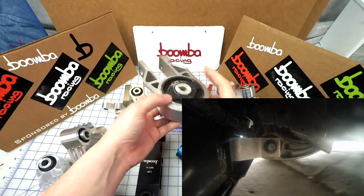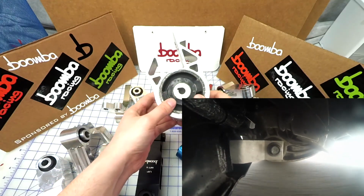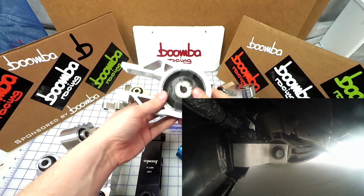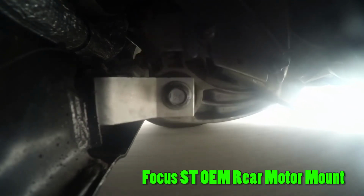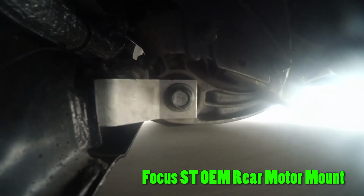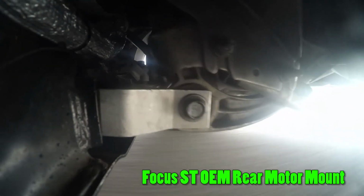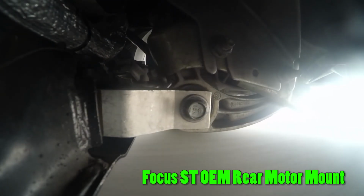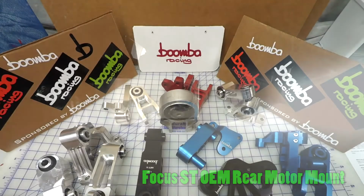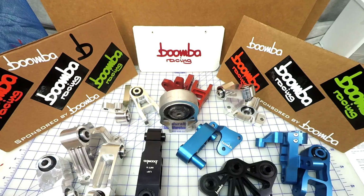So it's good for comfort, but the downside is you're trading off a lot of performance on your vehicle. If you drive in any sort of aggressive or spirited manner, you're going to find that you have a lot of issues relating to the motor mounts. Some of these issues may include wheel hop, difficulty finding gear, any kind of wheel spin, and a lot of other negative, vague feelings coming from the drivetrain.